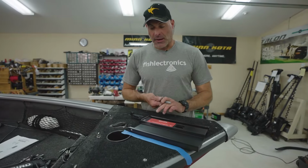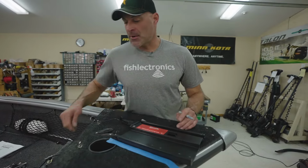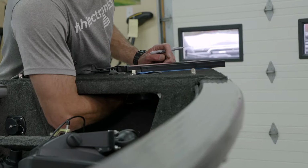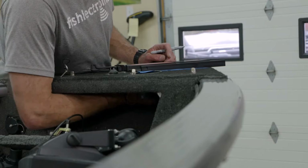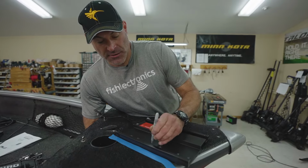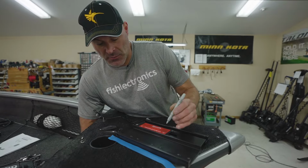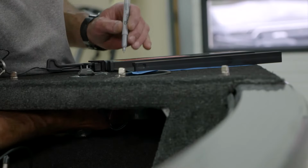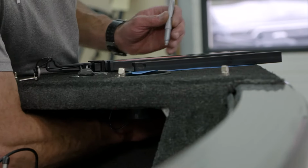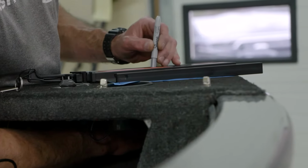So we have the quick release bracket plates apart, okay? Our holes are now exposed. I'm gonna reach underneath through this access panel and feel what holes I can use. We want to get at least 4 in there, okay? 4 will securely fasten the motor to the boat, and I know I'll get that one. That one's free and clear, as is that one. And we got 2 on this side too that are free and clear. So I'll go ahead and mark those.